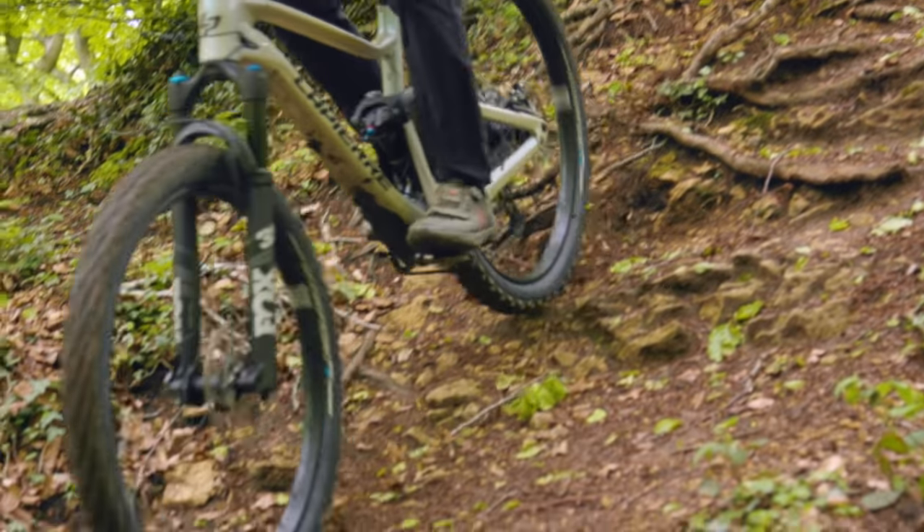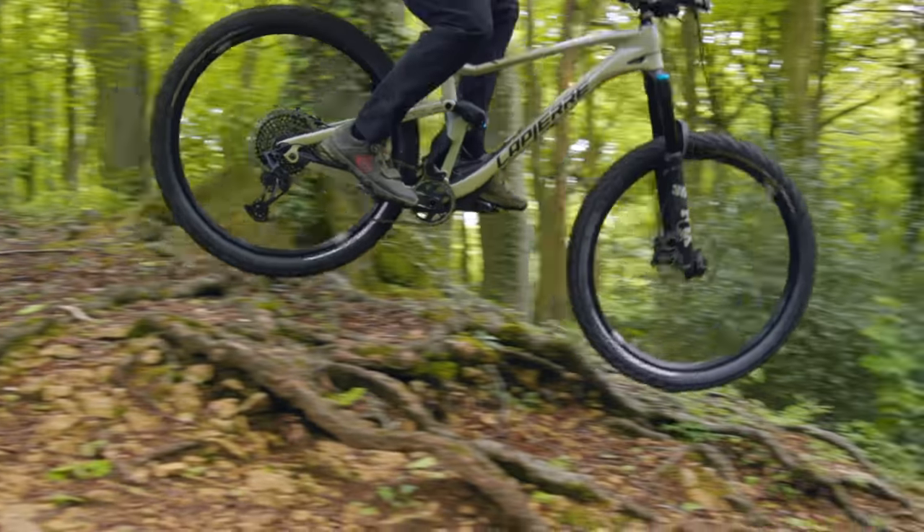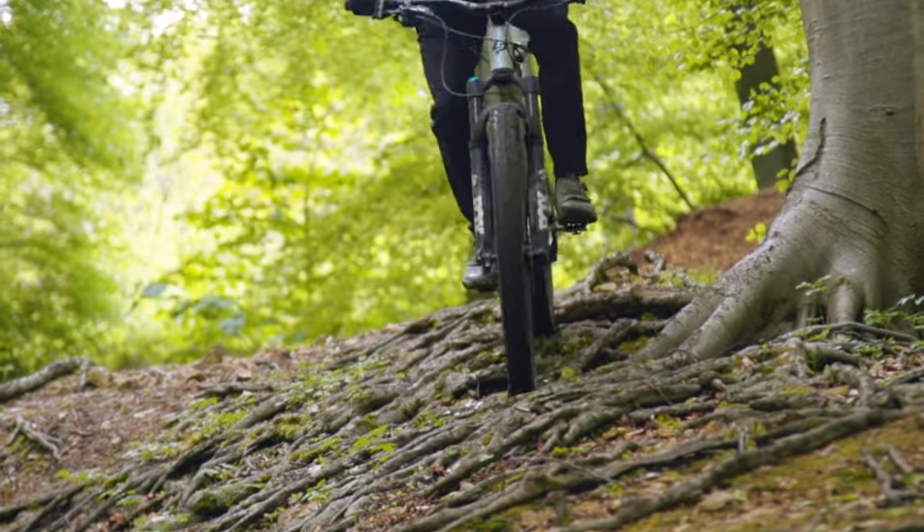Conversely, if you're riding on smoother terrain and perhaps at lower speed, lower pressures will allow the tyre to deform more, enabling it to better mould to the ground shape, boosting grip. There's some nuance here to appreciate — a track in the dry might be very different when it's wet, so your pressures might have to change depending on trail conditions. A rider's style might also need to be taken into account. If you're more precise with your riding, weaving smoothly through obstacles, you might get away with a couple of PSI less than someone with a more point-and-shoot style.